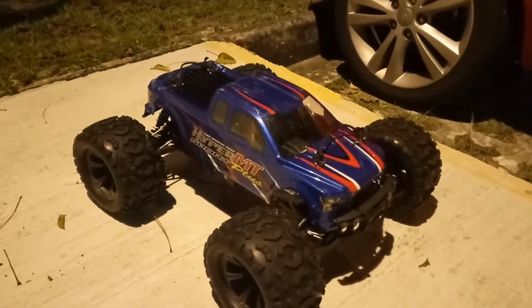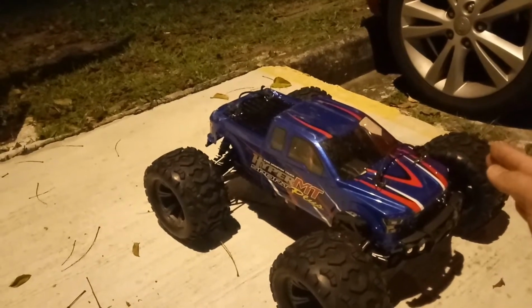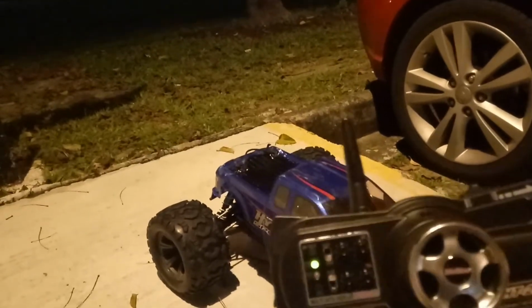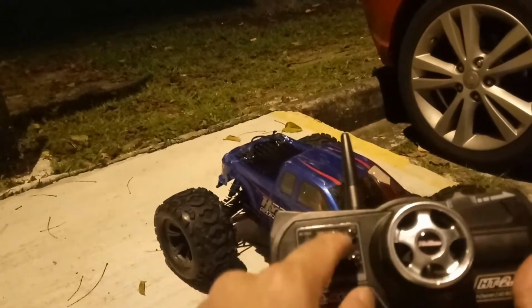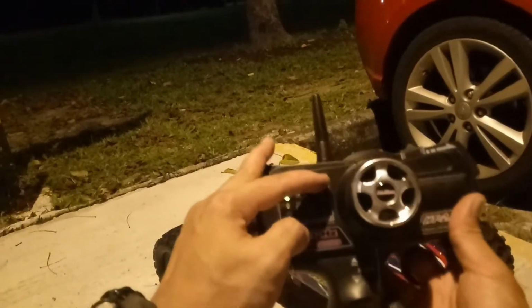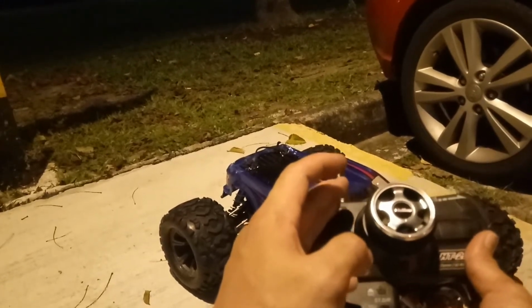So what I did was I tried some basic suspension tuning. I moved the front shocks, the top mount, to the outside. I reduced the preload on the front and increased the preload on the rear. And there's something else that is usually not looked at, the endpoint adjustments for the steering. I took a look at the servo and realized it had a little more room to move. For the right side, I've turned this knob to about the 3 o'clock position. The left endpoint adjustment is roughly at the 1 o'clock position, so it gave me a little more steering throw.